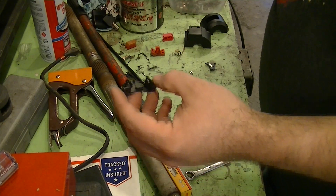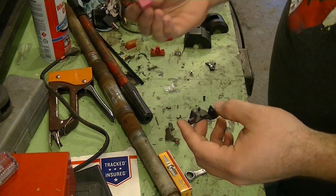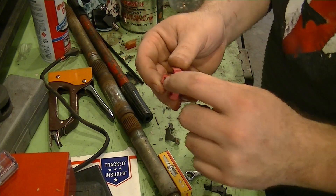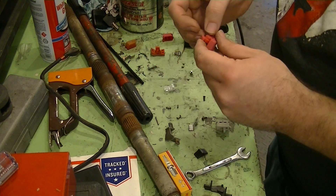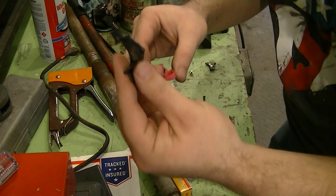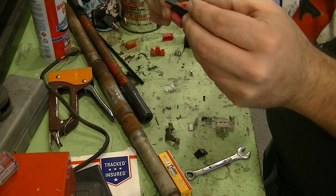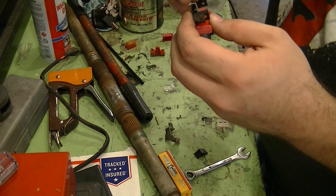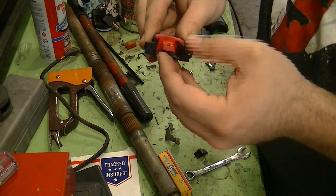So we're going to begin reassembling the switches. I'm going to start with the engine kill switch. I've got my nice pink switch here. I've already popped one spring in place on the edge. Another spring goes down here with a little ball bearing on it. There's a little detent area right here. I want to put this in, squeeze it like so, and then push that ball down and clip it into its detent. Now it rolls back and forth and stays in place.